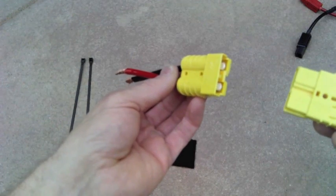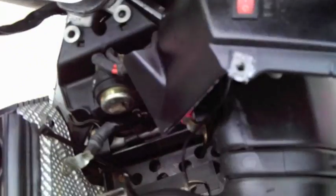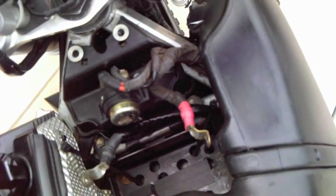Batteries also come with an option to have a dual quick connect. After you remove your original battery, make sure that your battery box is cleared of all the extra parts that you don't need. The next step is to check to see which position your battery will fit best in your battery box. The additional element is this accessory cable, which I'm going to install in the same place that I had it before.